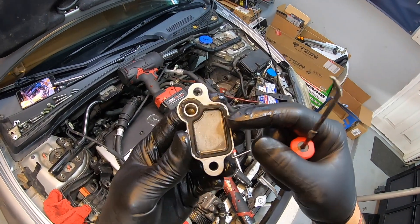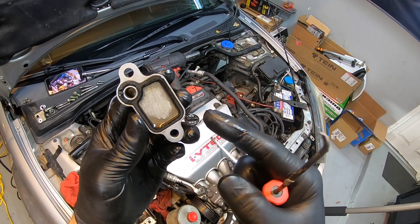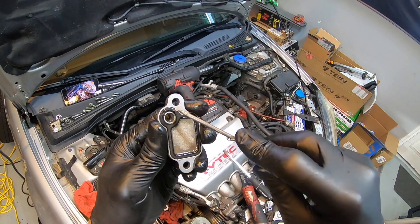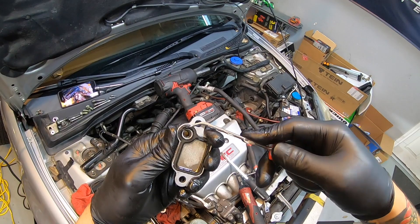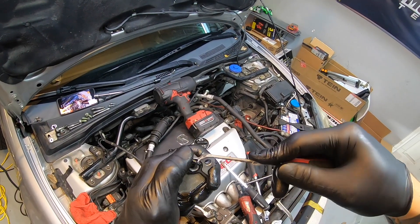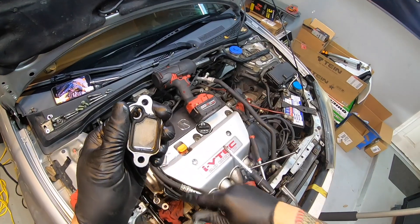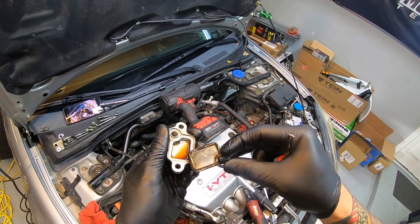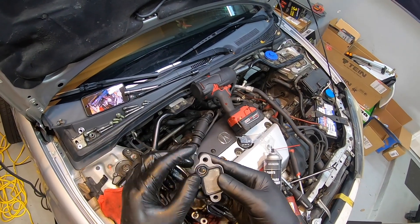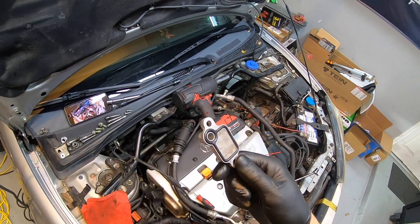You can see there's a little bit of debris up in here — that's what it's made to do, filter out any debris that can get into the head or into the VTEC system. What happens is why this actually leaks is because the rubber gets hard over time. This car being as old as it is, it's definitely time for all the rubber to start leaking. It gets hard, it shrinks, and you end up with leaks everywhere. You can also get a check engine light from this filter if it gets filled up and the flow of oil gets impeded. These gaskets usually come in a three-piece set — you get this one, the VTEC solenoid, and the pressure switch solenoid. They're like $6 to $8 for the whole thing. I'll leave a link in the description box.